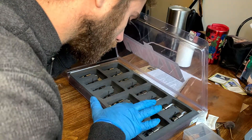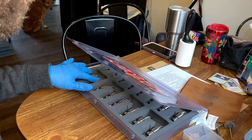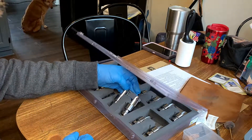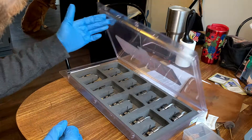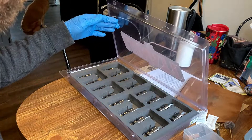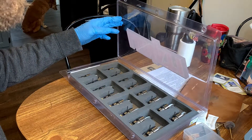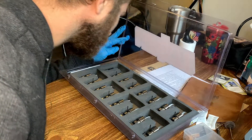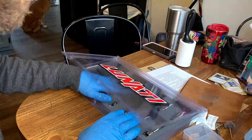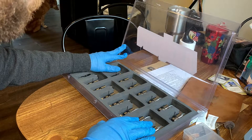The thing that would suck is if you don't do this and then you have no oil to the top end. With the heads I'm running, you can't take these tie-bar lifters out because they're so tall — you'd have to take off the heads. It's very frustrating if you have to redo it: you have to remove the heads, the intake manifold, the carburetor, everything on top. It's just a little detail I have to do to make this work. So I'll fill these full of oil and let them sit until the motor is ready to go back together — that's pretty much it.